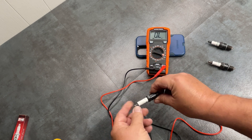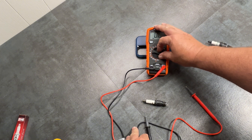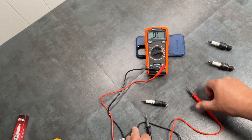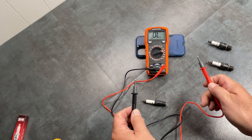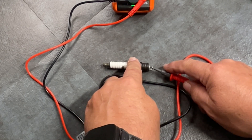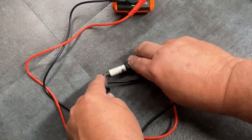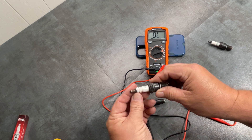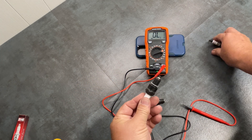I'm just letting you know how to use this. This is the ohm reading. You can also turn it up to the continuity setting — that's this little sound symbol. If you get continuity, you should have continuity from this end to this tip. You should never have continuity from the tip through the porcelain insulator to the body — that's another way to check if it's bad. So again, both of these failure modes can happen.